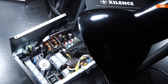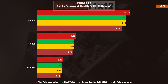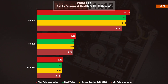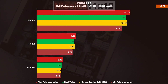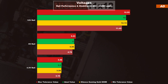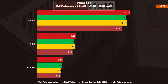Now let's move on to my basic testing and measurements. Starting with the 3.3, 5, and 12 volt rails at idle — the PSU is already offering close to ideal values. Under load, the 3.3 and 5 volt rails remain strong, but the 12 volt rail shows a slight deviation. However, 12.15 volts is still totally fine.